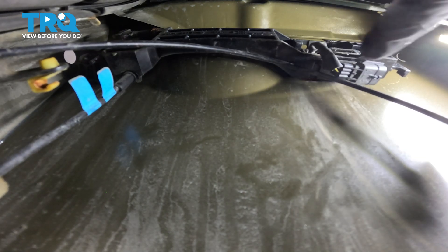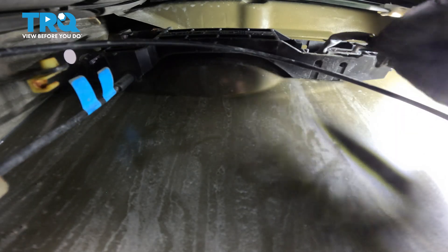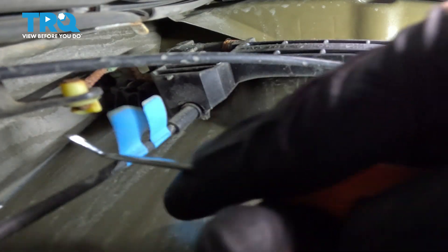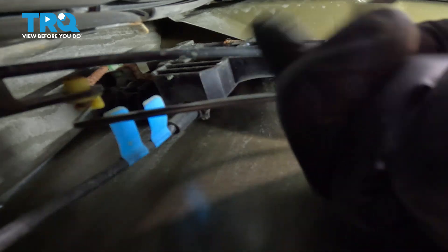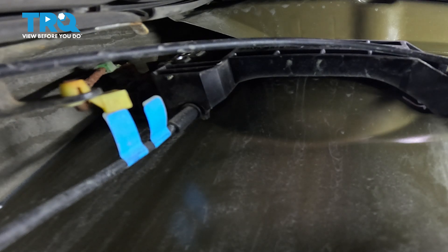With the wiring harness disconnected, the next thing we have to do is dislodge this from this plastic piece. We'll continue using some long nose pliers, squeeze on the two locking tabs along the top, and you should be able to pull this down and out of place. Now let's continue following that door handle. What we're looking for is the lock rod — we have to disconnect it from one side or the other. You'll find a plastic connector that goes over that locking rod and holds it in position. We have to separate this using a small pick or small screwdriver. Once you have the lock pulled out of place, continue on by sliding the rod out of there.